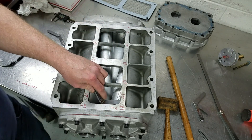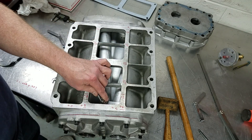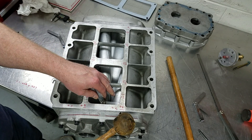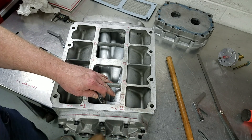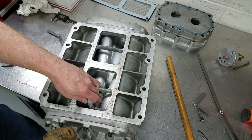Sometimes it's easier when setting the bottom clearance to start out tight and then run your feeler gauge against the rotor in the case. If you need to loosen it up a little bit, a rawhide hammer on the end plate works really well for tapping it down in small increments — just a little tick is all it takes.